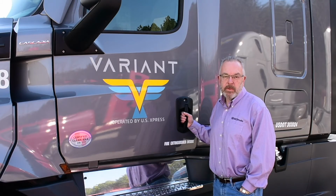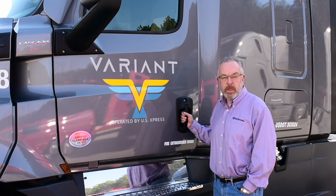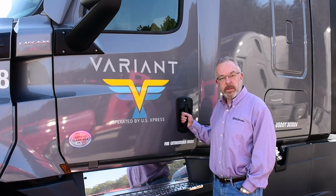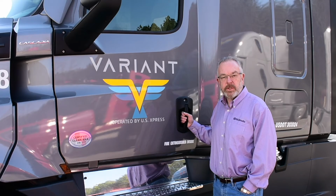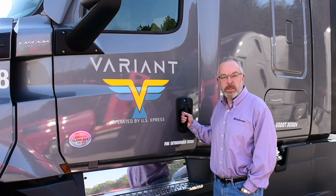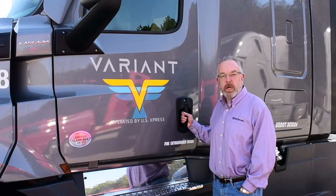In this video I'll be showing you how to operate the APU and how it integrates with your truck and inverter. We'll show you how the system can provide you with unlimited heat, air conditioning and 110 volt power no matter how long the stop or severe the weather conditions. But before we begin, let's review why it's important for you to use the system.